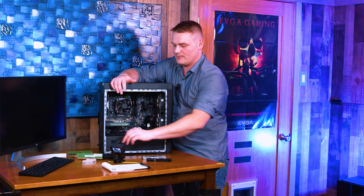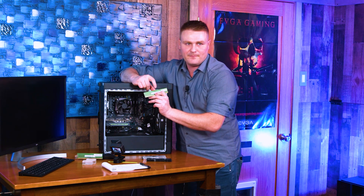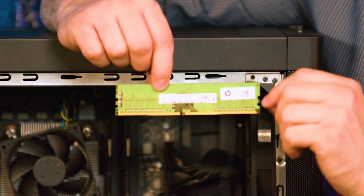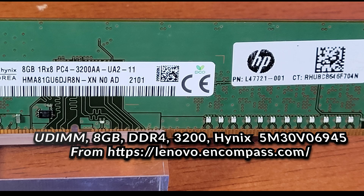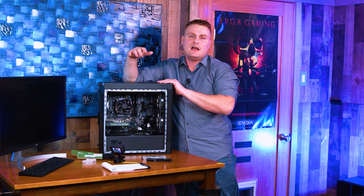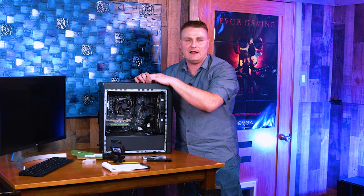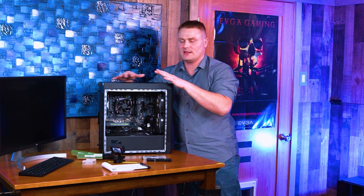Something I didn't talk about in the beginning of the video: this RAM actually says it's 3200 and it's a Hynix brand — I will throw the labeling down in the video for you guys. You can order the RAM from either Lenovo or HP; I'll have links in the description below. Hynix 1.2 voltage RAM — they're using the same RAM in these PCs. The BIOS is non-upgradable; there's no XMP profile in this Legion to allow you to adjust the RAM. With the Intel variant, there's nothing you can do.